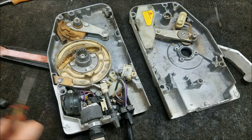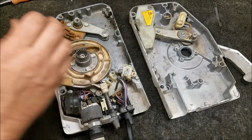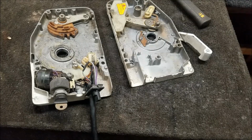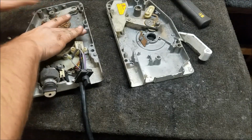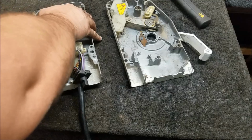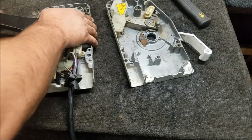Anyway. So, remove the cables. Pull that pin. Cable can then wiggle up and out. There's one cable that's out. Put the pin back in so you don't lose it. Usually they're nice and greasy, just as this one is, so it doesn't roll away that easily. So there's our pin for that one.